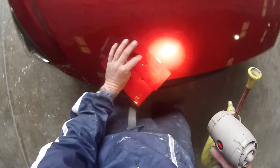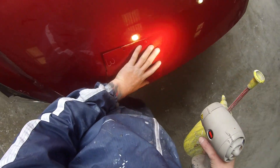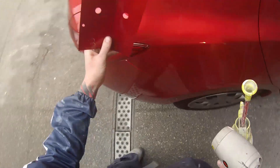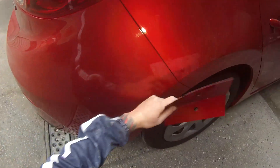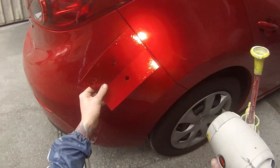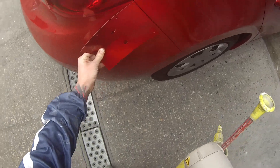When I'm color matching I just go check it to the rear bar, because I just did this front bumper bar. The one on the left is two coats of the candy, the one on the right is three, so you can see how it changes the color. I always like to have a good look around and check it on different angles — get your eye on the different angles, the tops of the doors, the bottoms — and just have a bit of a look around. You can really see the difference that the extra coat of candy made; it really deepened it up.